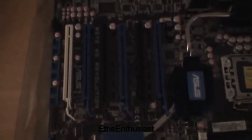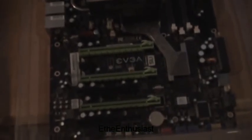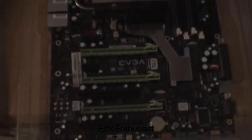Those are the three blue slots — they will provide three times 16x at 5,000 MB/s bandwidth for 3-way SLI. And those were the green slots — only the first and third was providing the full bandwidth; the second one was the bottleneck, at 16x 1.1, which is 2,500 MB/s. So now I will start building the new system.